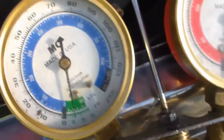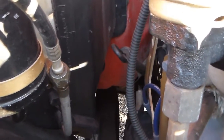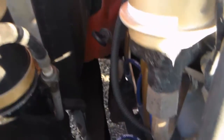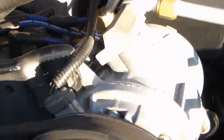I found my problems. I pressure checked it and right off the bat discovered a leak right at the inlet from the high side into the evaporator. In fact, there was no o-ring on it and the line was loose. I forgot when I pulled the orifice tube out — I forgot to tighten this line back. Also, the manifold on top of the compressor was loose. I now have all the connections tight.